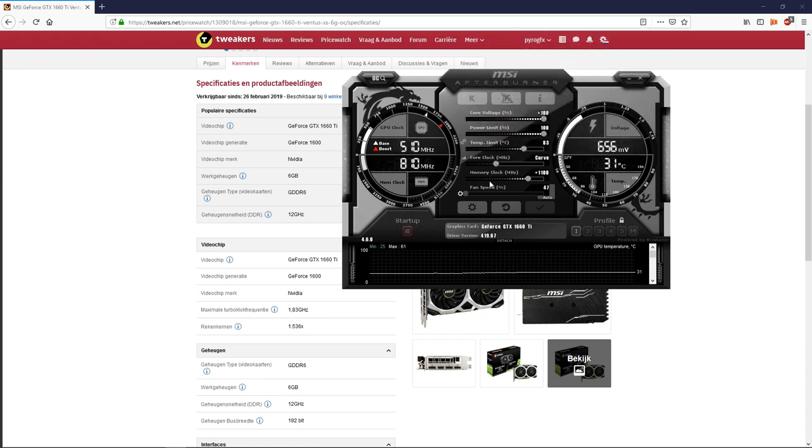It is around 83 to 90-ish MHz. Keep in mind, it's not just a simple 90 MHz overclock — it's 90 MHz above what is already factory overclocked. So it's quite reasonable. As you will see in the benchmarks, it will boost the clock to the 2015–2030 MHz range on the core clock. That's pretty reasonable for a card of this sort, and it's not even water-cooled.